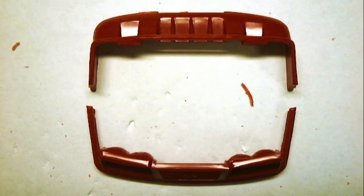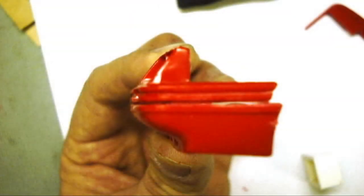Note that the SVO air dam is not bowed out as the headlight panel from the 84 Mustang. Also, the outer front corners of the SVO air dam are ever so slightly wider than the 84 headlight panel. I used a file to carefully shape the air dam to match the contours of the headlight panel. Notice also that the filler panel on the SVO air dam will need to be trimmed to match the wheel well opening, and this should be done after the parts are permanently attached.